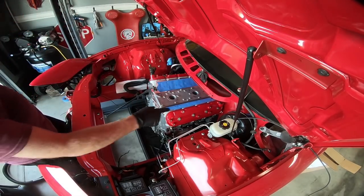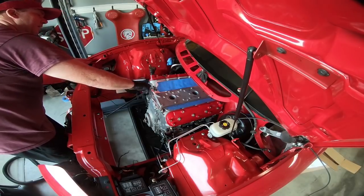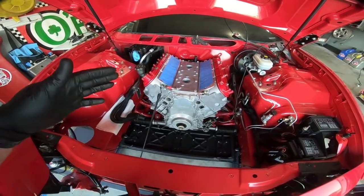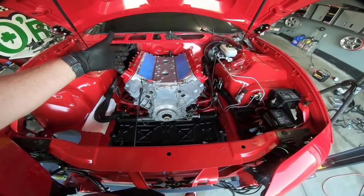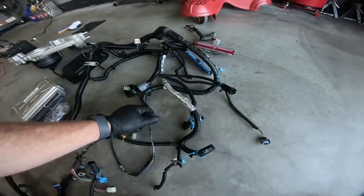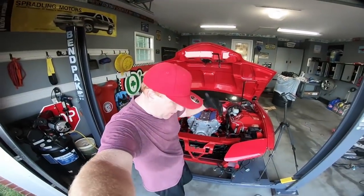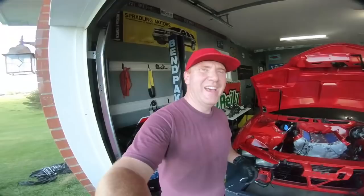Once we do that, I already have the plug in the back here. There is a vacuum cap that is a separate part number that goes here, and your new connection will be to the throttle body up front — we'll show you that once we get the intake back into place. Normally the next step would be to put the knock sensors into place and then the harness. I noticed my knock sensors are rough and I think I'm going to replace them while I've got this apart — I recommend that any time you take the intake off. A lot of people also replace the wiring harness while everything is out of the way.